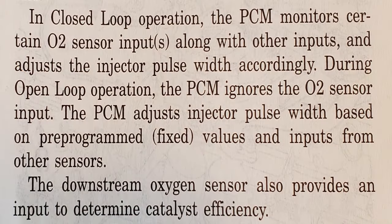That's your problem — you've got a drunk upstream O2 sensor. So we know it doesn't work now because we unplugged it. Now we have a check engine light, and it's reading that you have no O2 sensor. So we've got the default mode, it runs better. We're going to go into the auto parts store, pick up our O2 sensor that we ordered online.